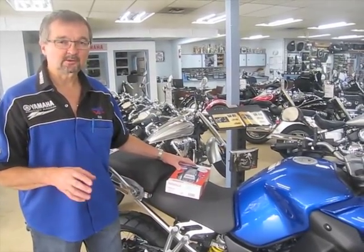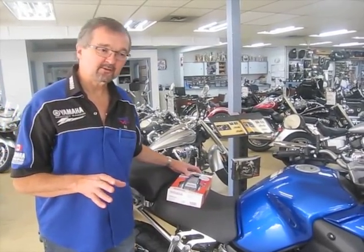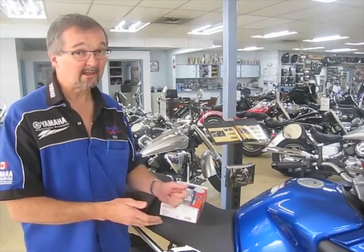Lastly, your battery. If you want your battery to last five years or more, there are certain things you've got to do. In the old days, we would take the battery out and charge it up every 30 days with a conventional charger, checking it with a hydrometer. Usually we forgot about doing that, and those are very often the customers who come in sometimes every year to buy a new battery.